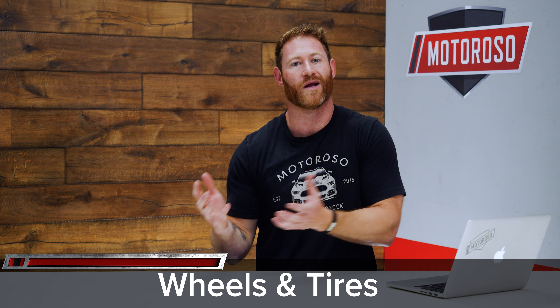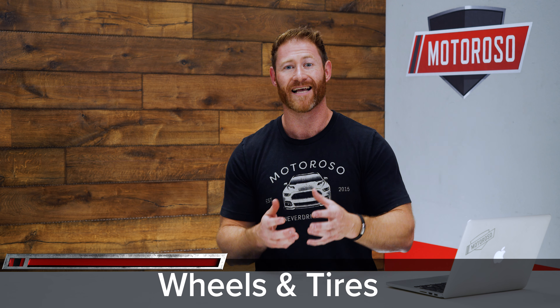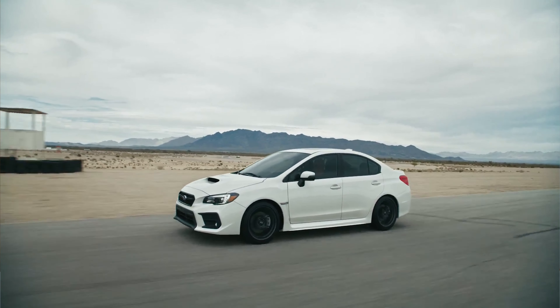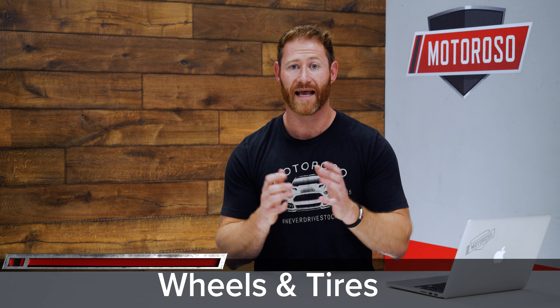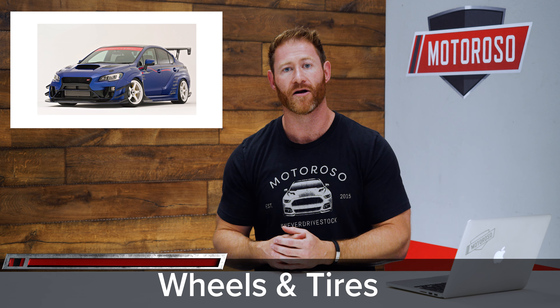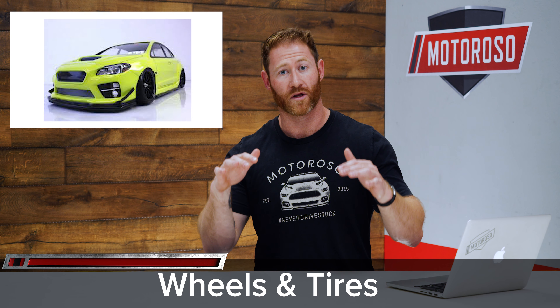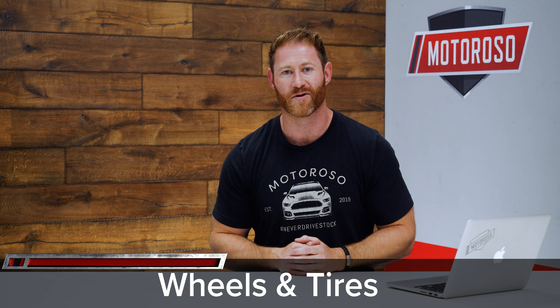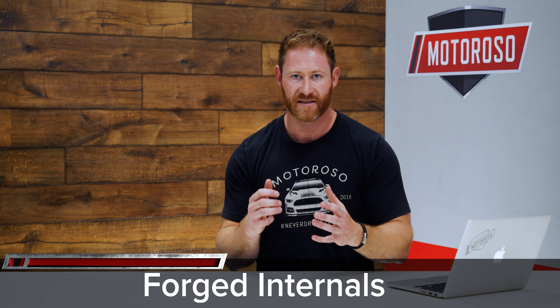No build is complete without upgraded wheels and tires, and pretty much everybody does this mod. There are thousands of options, and design is a personal choice, but on the WRX this is especially important — Subaru didn't update the wheel and tire sizes when they moved to the big body styling, so the wheels are too small, offsets are too far in, and they can't fit a big tire. We encourage running an 18-inch wheel with a maximum width of 9.5 inches, which allows up to a 285/40R18 tire. If you want the car more slammed, go with a 285/30/18. Motoroso.com has tens of thousands of wheel and tire options to help you find what works.